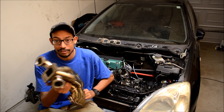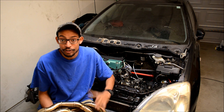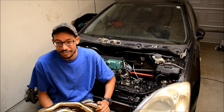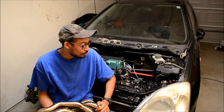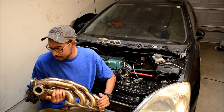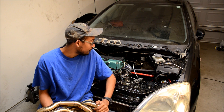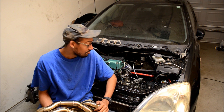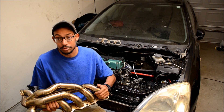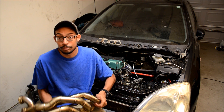We went with the twins — pretty sure I showed you guys already. The manifold has not seen a car yet, so we're gonna hope that it fits. If not, we'll just cut something off and re-weld it and do it again — that's kind of the beauty of this. I'm more worried about wastegate position and turbo clocking position; that's the only thing I was really worried about when making this, but everything else should fit pretty good. Let's go ahead and put this on.